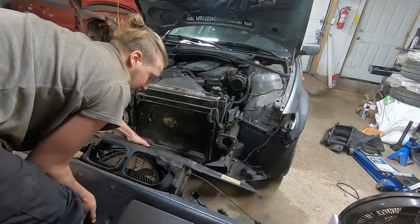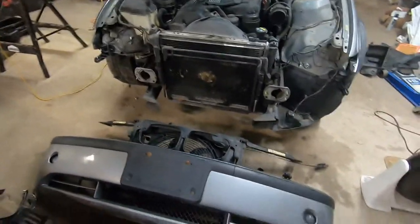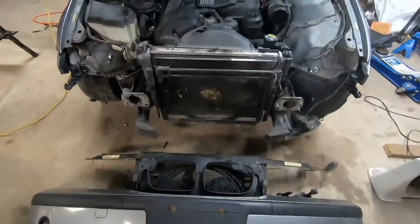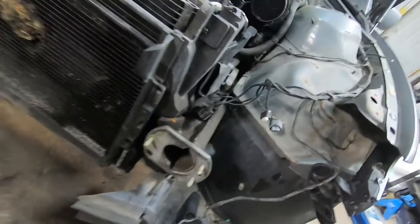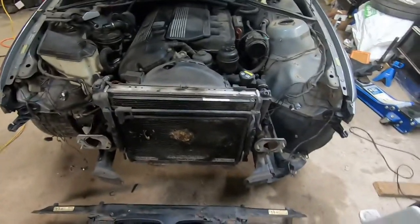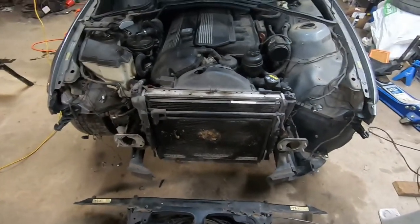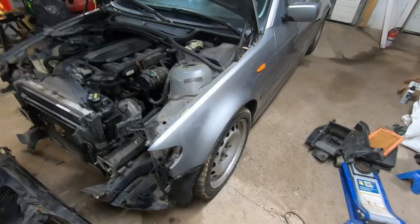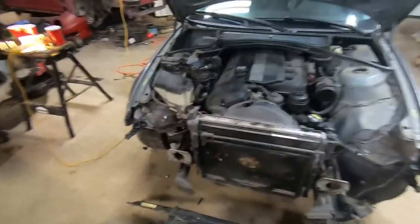Set it down carefully so you don't damage the bumper — standing it up is probably best. You can see the whole bumper with the AC fan, impact bar, and rad cradle all together. When you pull this off, note that there are a couple of little pieces up in here that go inside the frame, so you've got to pull it out a good amount before it releases. The other things to pull off are the radiator and AC condenser, as they got damaged in my accident — I'll make a separate video about that and also about removing the fender.